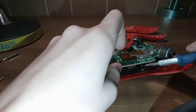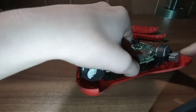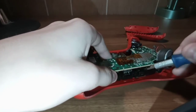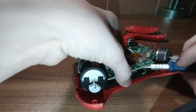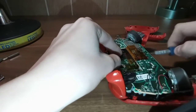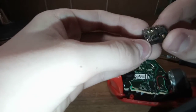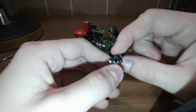Right there's your headphone jack - it sits in that spot right there. You just want to get it out. Might have to separate it more, which is okay. Just don't completely remove it to make the job easier - remove it through the back, just get it out of the controller. So here it is. This is what goes bad on Xbox controllers - it's this little device. You can see how it sits in there; it's got a little post right there that stops it from moving back and forward inside there.